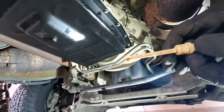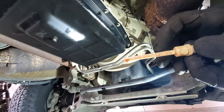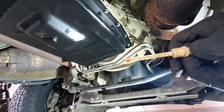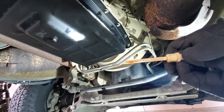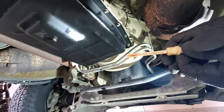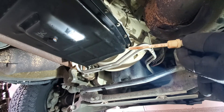If it's below there, I would definitely add some — maybe a quarter to half a quart before you check it again. You can leave it running while you add fluid to it. Just add your fluid, put your dipstick back in, pull it out, and check it just like you would your engine oil. The only difference is you've got this hot catalytic converter that's kind of in the way.